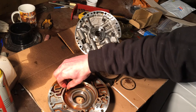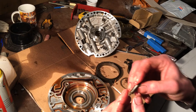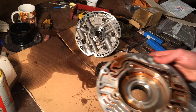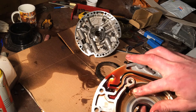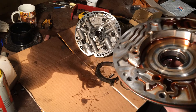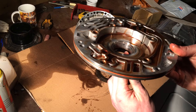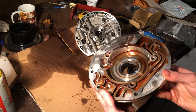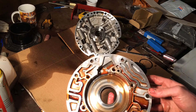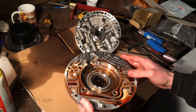I'm going to pull this pin out — it looks like it can come out. There's our pin; it has a little point on it that goes down. It looks like there's a spring and possibly an O-ring underneath that pin, so we're going to leave that alone for right now. But can you see in there that bushing? See how it has all these spots — it's all messed up. That's the one I'm waiting on. There's a special tool to remove and install this bushing, but honestly I think I can get away with using my cam bearing tool — it's basically the same thing.